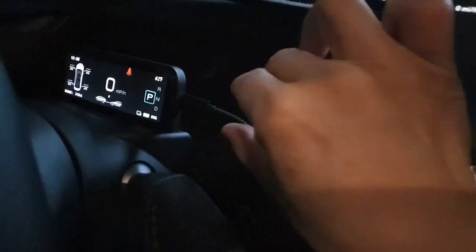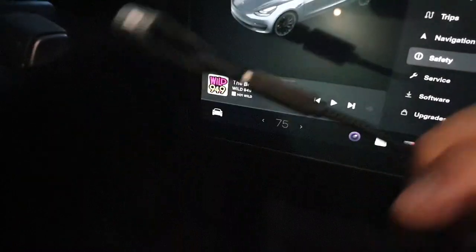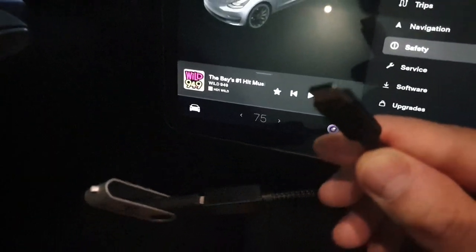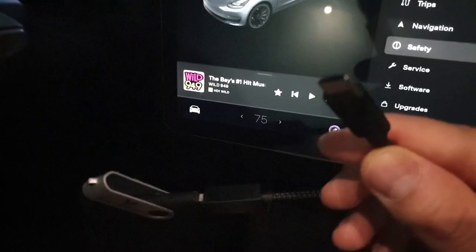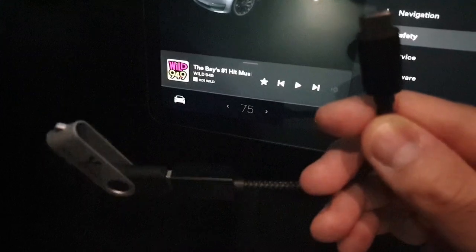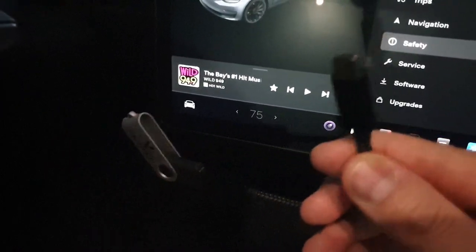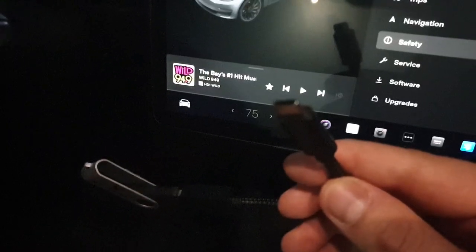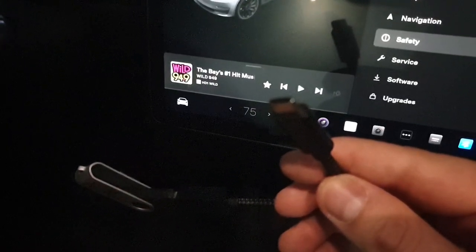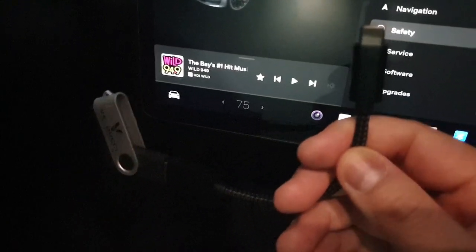Once it says it's fully updated and comes back to life, you just detach it — no safety steps needed at that point. You can see it's a Type-C cheap thumb drive. They said eight gigs or less, and who has an eight gig laying around these days? This one happened to be four gigs. I formatted it to FAT32, downloaded their firmware, and had to use some sort of RAR program to unzip it.